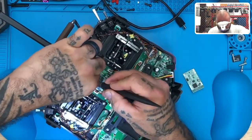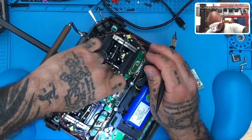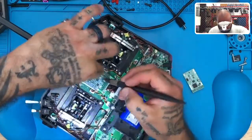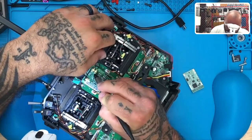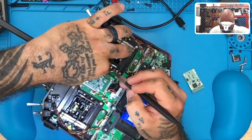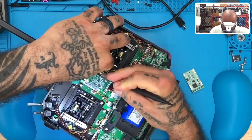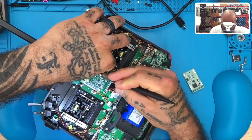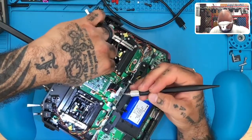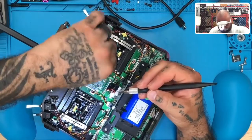There's one, there's two. You can just twist these off, but if you want to be really careful with it, just put a small little cut in there and then turn them — it's even easier and it puts less stress on the UFL connection on the board itself.